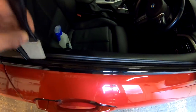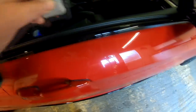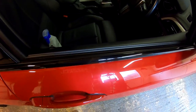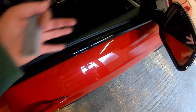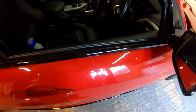I've also got this little Alibaba tool which is quite useful because it's able to get into that gap and I can work it along there. What I don't want to do is soak this felt so it's soaking wet, because we're still in late winter/early spring conditions and that water isn't going to evaporate. If it's not dry when you bring the glass up and down, you're putting more moisture in there. You could use a hairdryer to dry it out, but that's getting a bit ridiculous. So let's crack on and actually clean this.